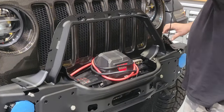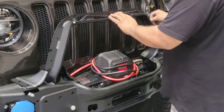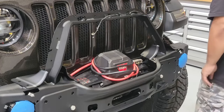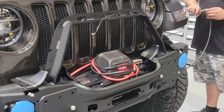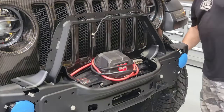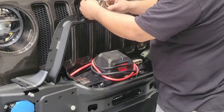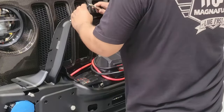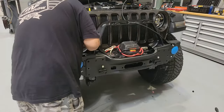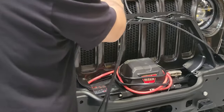One of the cool parts about AEV's hoop design is that it is a two-piece design, which means we can do all of our mounting and organize our wires behind the structure, and the cover goes over the top. AEV provides zip ties that mount specifically to the structure so you can keep everything neatly tucked when it comes time to put the cover on. I've taken the harness for the camera and wired it through the driver's side, along with the hose for the sprayer. I'm going to leave both those items on the driver's side and run both of the 7000 series light harnesses from the passenger side — this keeps everything balanced and doesn't bulk up wire on any given side.